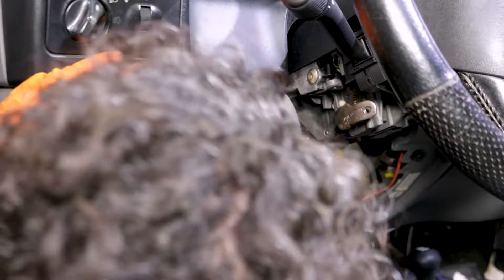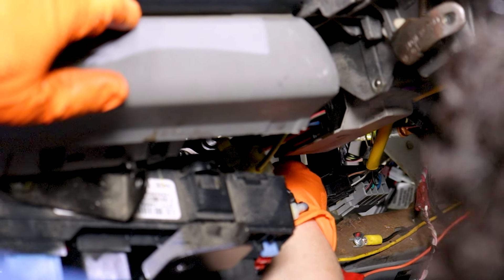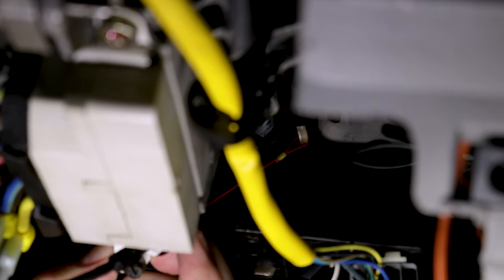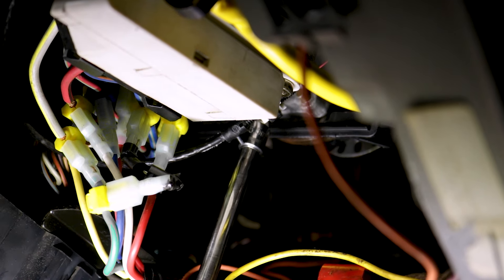Now we can remount this ignition switch — it should line right up. That's a 7-millimeter socket, and you should notice the black part of the connector plug slowly going into the white switch; just snug it up once it bottoms out. If it doesn't go smoothly, something's bent, so take it apart and re-look at it. This is going to go back up in there and locks right up on the metal brackets as little guide pins. Now the harness is up and locked out of the way. Now I'm going to hook up my indicator cable. I like to try to loop the cable first, then bring this white mounting bracket down — it fits right in there. This is that little 5.5-millimeter socket; this only has to be snug.